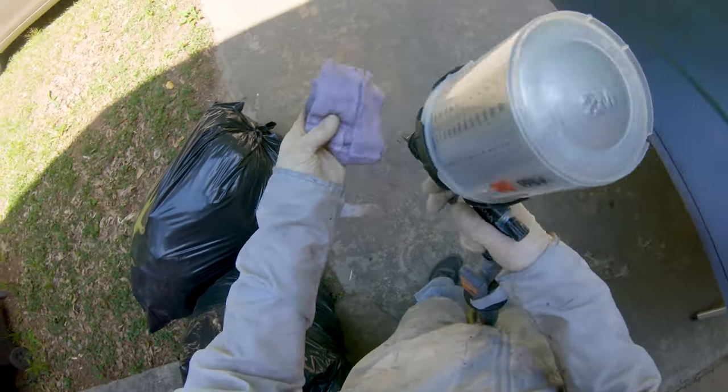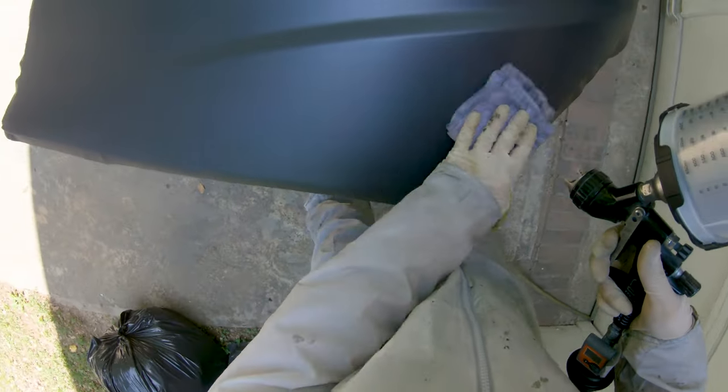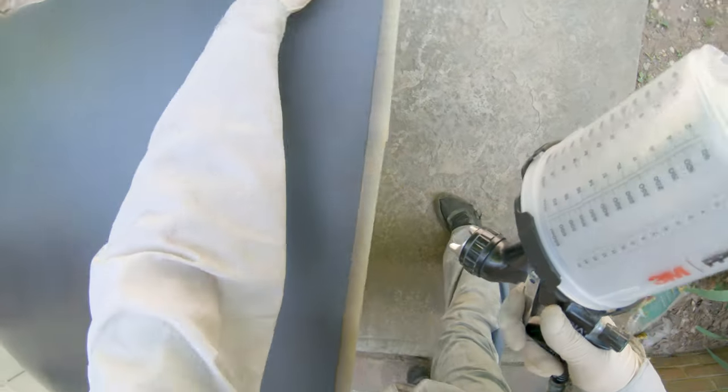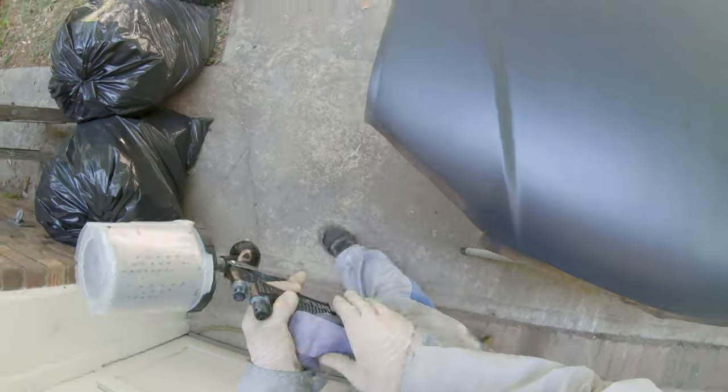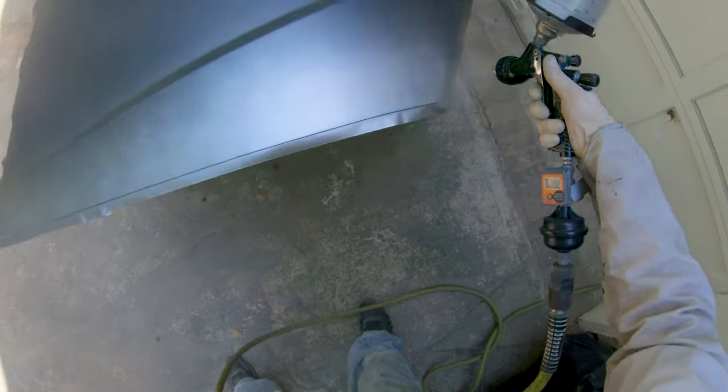As long as you're good and dry, go ahead and tack again before you start spraying the base coat. If you're spraying solvent base coat, you can tack between each coat if you'd like, or if you notice any little specks have gotten in the paint. Then start spraying your first coat of base with a good standard 50% overlap.